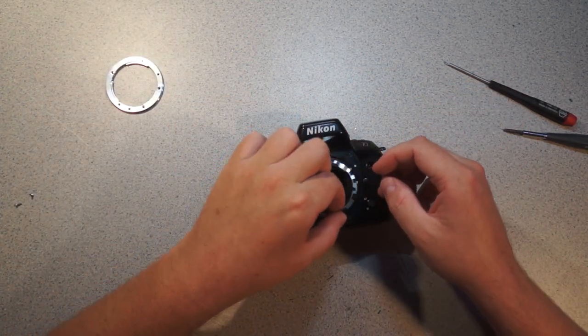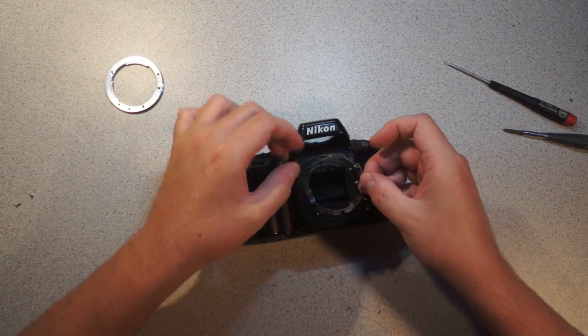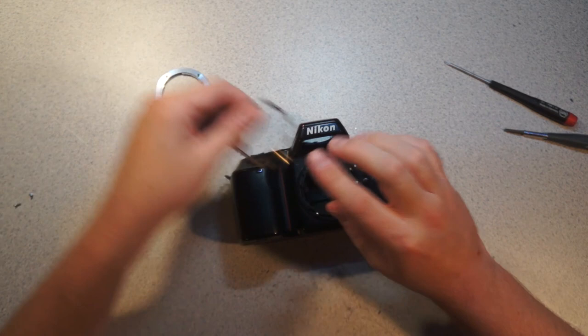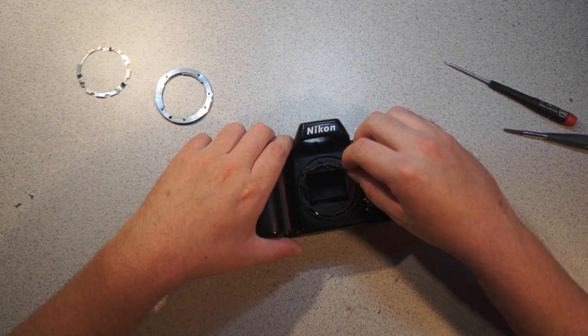They just have a lot of different sizes is basically what it comes down to. And then they just choose the shim that manages the proper offset so that the lens to film plane measurement is exactly what they need for the particular camera.